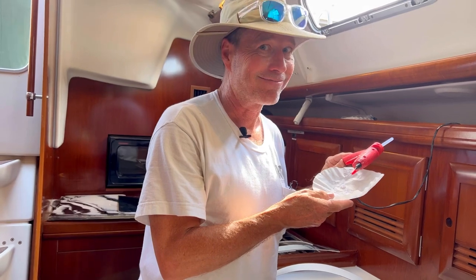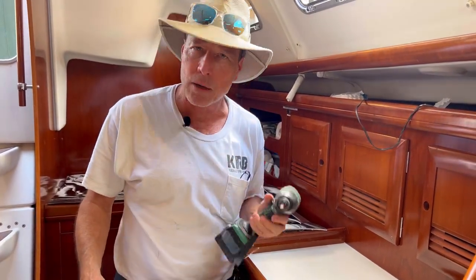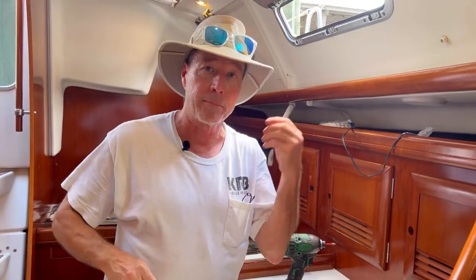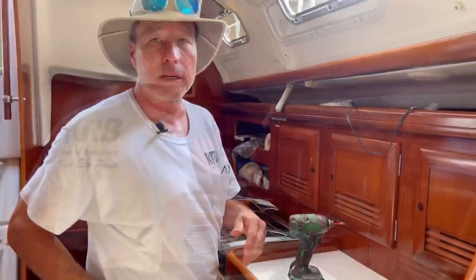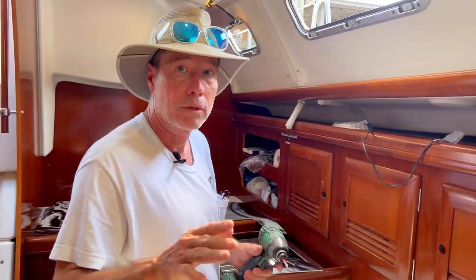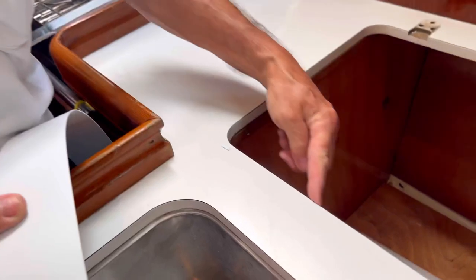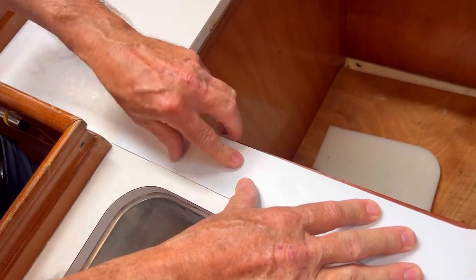Every crafter has to have one. We're crafty — we're sailors. We have to be crafty. And then we're going to use a saw, which is outside. You may need a screwdriver, but you don't have to have a power screwdriver. Because when you take the hinges off of this hatch, they come in two parts — the female part and the male part. The female goes underneath, the male goes through. Seal it up with silicone afterwards and you're fine. You can get them at Max Marine or Pro Marine or any marine store. We're going to line up the edge of the template material directly flush with the hatch edge, and we're going to glue it down.